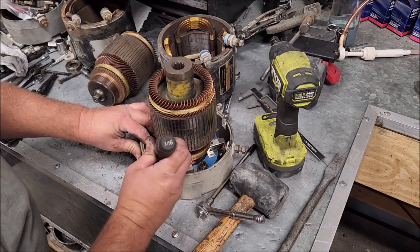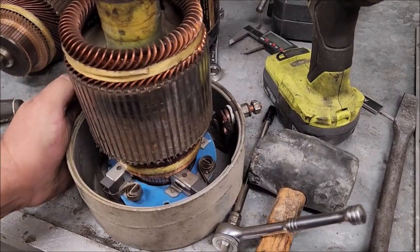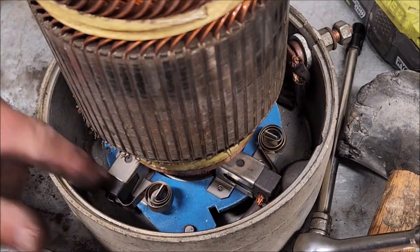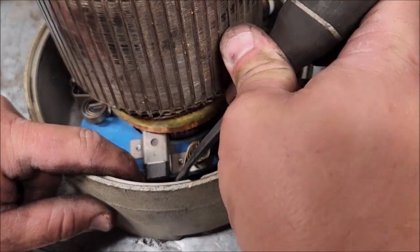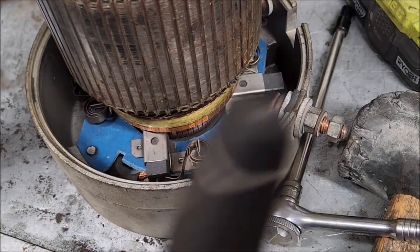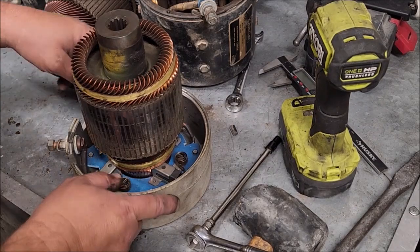Push the brushes in, get in there and get these springs back on the back of the brushes - just like that. Let me zoom in on one so you can see. See on here - I've got that spring pushing on the brush so the brush rubs now. Over here it's not because it's below. So you push that in, get that spring back out to where it's supposed to go. Alright, now that's back together.